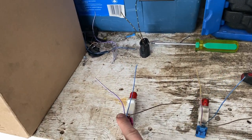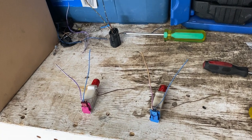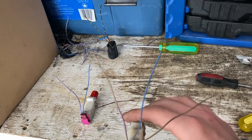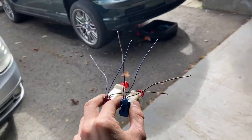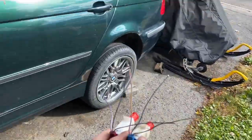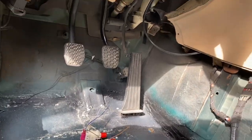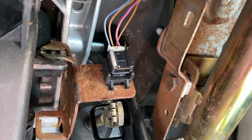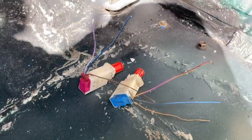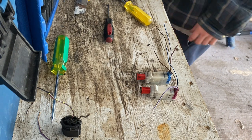When it comes to the 12-volt wires, these two purple wires we're actually going to connect to the brake switch — you don't have to worry about that because everybody has a brake switch, whether it's manual or automatic. That's where we're going to get our voltage from, and we'll get our ground from that brake switch as well. I already installed my pedals and bled my clutch, so it's going to be a bit more of a headache for me. I strongly recommend doing the wiring when the pedal assembly is out. This is your brake light switch right here — as you can see, the purple wire I was talking about, and we also have our ground. So there's our 12 volts and our ground. I'm going to install the switch, and before I do that I'm going to splice all the wires and make everything look nice.